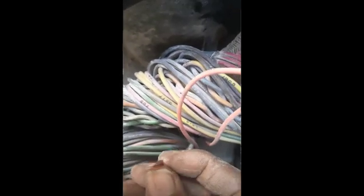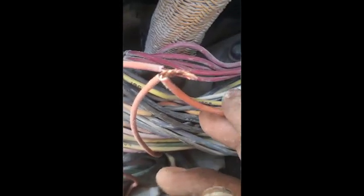When we fixed the wire here, our voltage disappeared — therefore the error was coming, showing 8 volt DC supply low, because there was a short. Now I have cut this wire and put in a new wire. I have run this new wire separately to the sensors. Now my circuit is okay and I am getting the 8 volts. The harness is very big and very difficult to remove, so as a short fix I bypassed the wire and put a new wire. Now my circuit is okay.